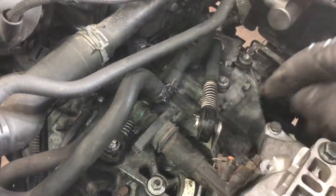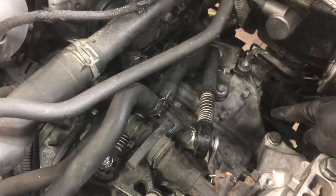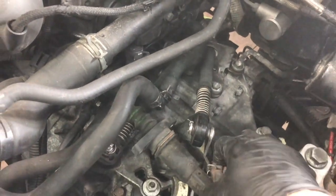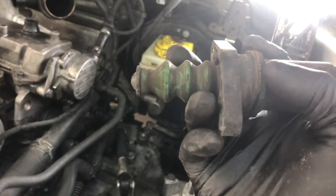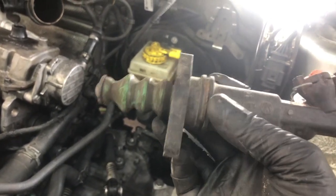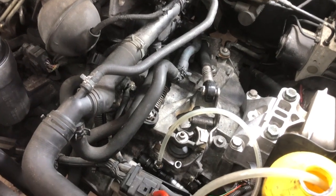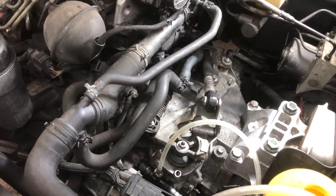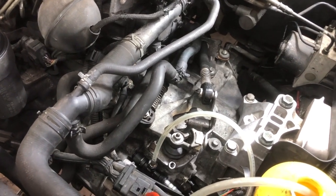So your line from the clutch pedal will come up through here and in. Just so you get a look at the slave cylinder for a 5-speed. This flange right here bolts onto the top of the transmission. This sticks in and hits the actuator arm or the clutch arm. Again, if you get all done, you sit down in the car and you push the clutch in and it engages really, really low, or it just flips straight to the firewall, just bleed the clutch again.